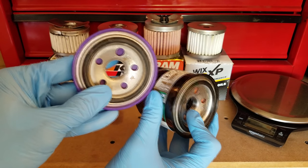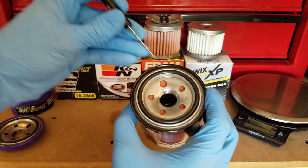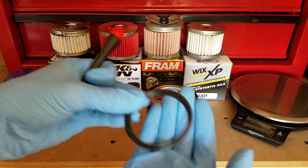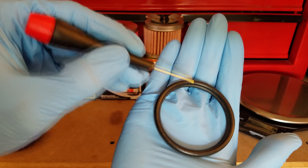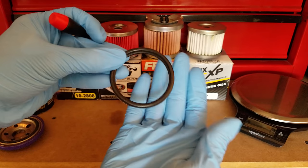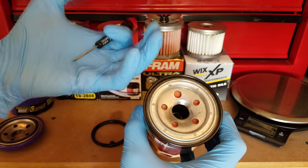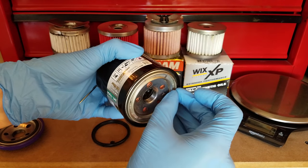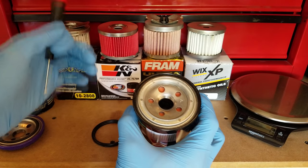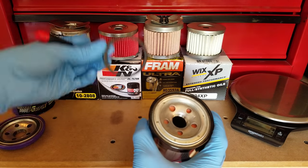They both have four and a half threads on their center hole, and they both share the same gasket and gasket track design. I actually like this gasket design quite a bit because unlike the rectangular cross sections of gaskets you see on the competition, this one has a little bit of an unusual shape — it's rounded on the engine side with a lip on the ID, and the back side is flat. That lip on the ID engages an undercut on the ID of the track and keeps it mechanically locked, so it's not going to come out. You really need a tool to get it out, which I think is a better design than rectangular ones.